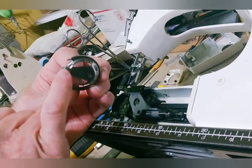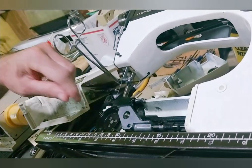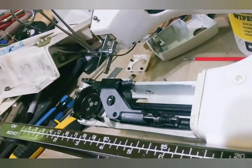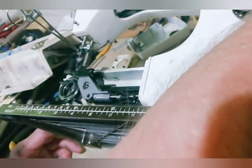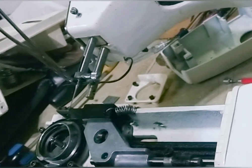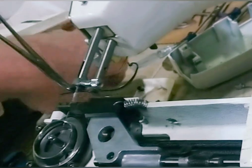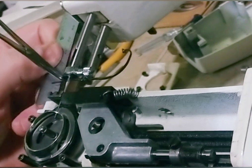You realize there's a tang right there on this hook assembly, and it has to go into a slot right here on the carrier. That's how you know it's properly lined up. Now here we go again — needle in the operating position, going down to its lowest setting. Here it goes. And now it's going to start back up again from there. Our super high-tech indicator.